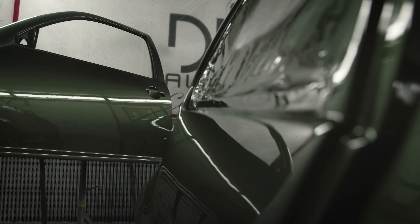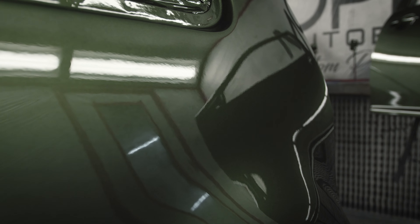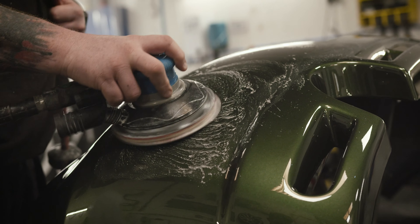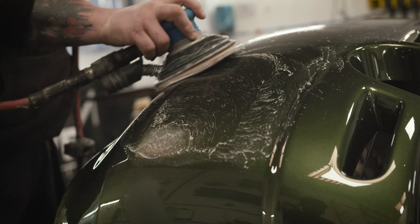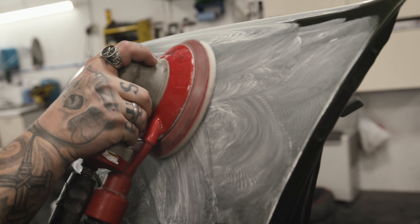After the paint process we move on to what's called flattening paint, which is the polishing process to remove all the orange peel from the paint job you've just done. We're going to be using 1500 grit by DA, followed by 3000, and then polish it up from there. This is a process we find so important because it gives that overall finish so much more depth.